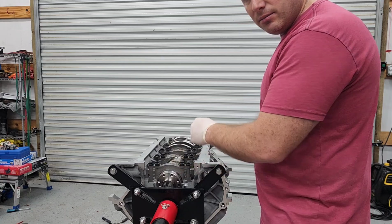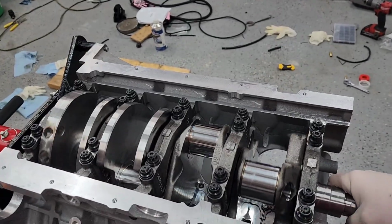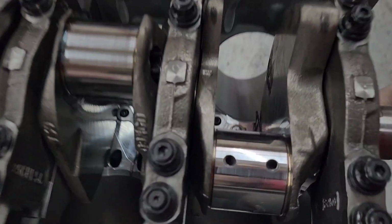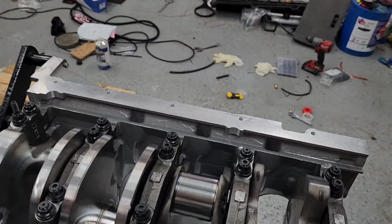Basically, we're at final install of the crank, and it turns nice and smooth. No tight spots. And the counterweights, it's pretty close to that squirter, but nothing's contacting. So next video I'll be putting the pistons on the rods, and then we'll be able to install the rods onto the crank.